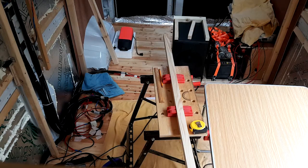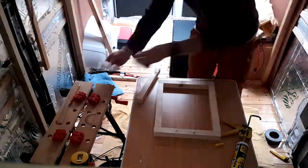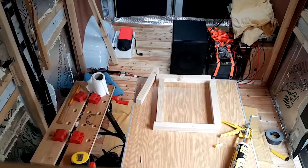I had to double up the batten at the back because there's quite a big overhang over the edge of the feet. I needed something to secure it to, using the little eyelets again, similar to how I did with the batteries — although I used less highly rated ones because it's not as heavy — but it's still quite chunky, so I wanted to make sure it was strapped down. I think I also glued this frame to the floor, much like I did with the battery surround, and screwed into batons under the floor as well. At this point I wanted to do something impactful with the electrical setup. The most important thing was definitely the lights, because I was having to work in the van due to a spell of rain, and this end of the van is really pretty gloomy even in the day.